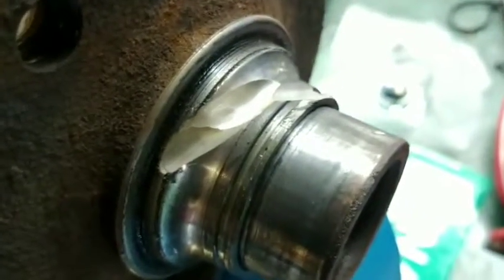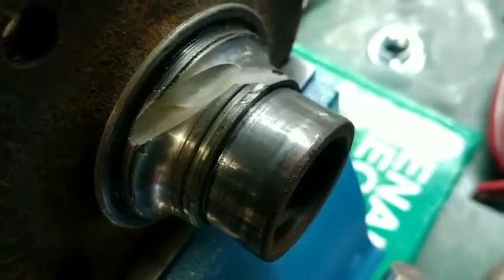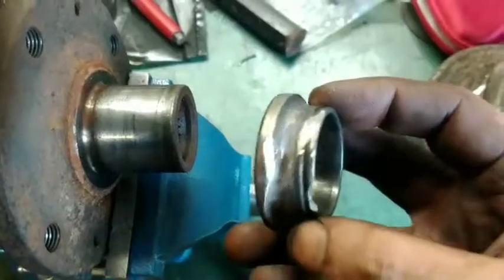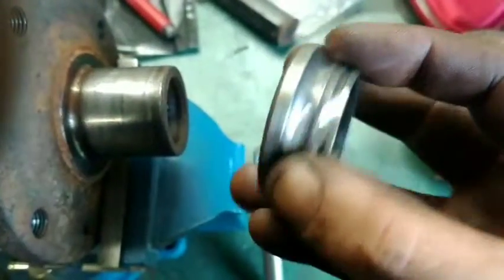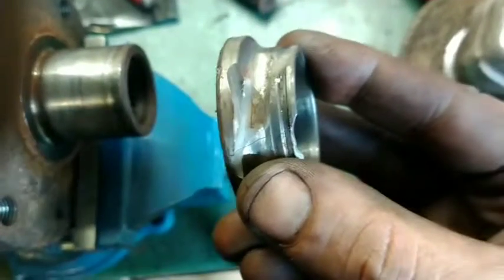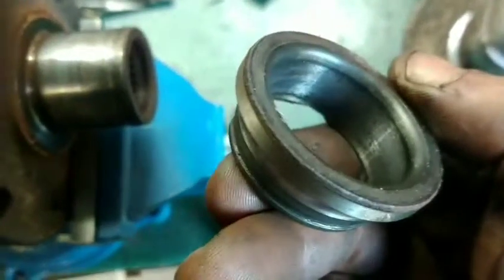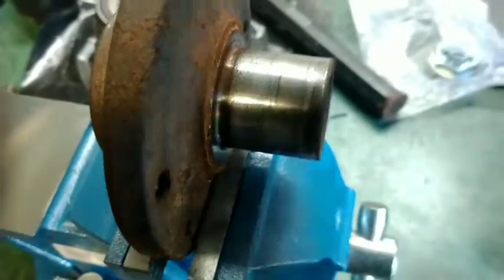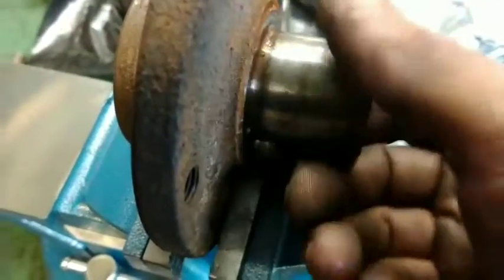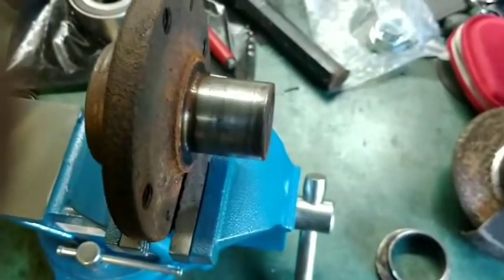See there — I've not ground all the way through it, so I'm not all the way through yet, but when I hit that hard with a chisel it'll crack it, and then it'll come right off. Once you hit it with a chisel you get a crack in there. I can almost not even see it now — just where my thumb is, going across right there. So the grind hasn't gone right through it, and there's no marks on the hub. That's just how the hub looks — the shine on it. There's no grind marks on it. That's how you would take it off if it ever gets stuck on like that.